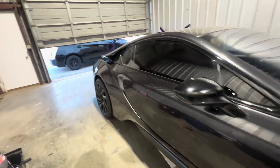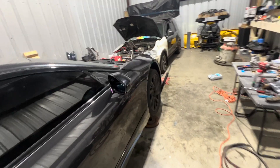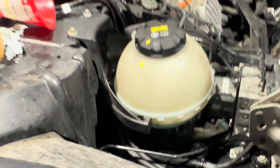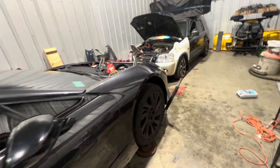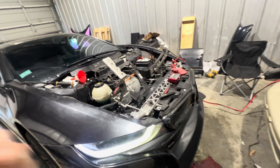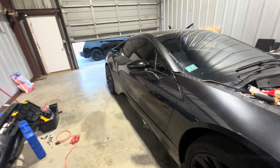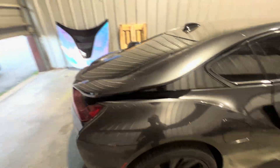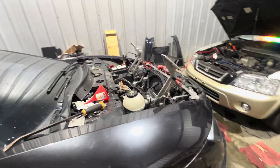That is the best way — well, not the best way. I wish the vacuum filler had been working for me, that would be a lot quicker and easier. But if you're struggling to fill the system, try this way — it's worth it and you'll have no headaches. Just make sure you monitor the cooling temperature and it doesn't get above 230 degrees Fahrenheit. I hope this helped. If it did, please leave a like and consider subscribing to my YouTube channel where I post tutorials and different stuff from my daily life. Hopefully you guys enjoyed this video — thank you very much, see you in the next one.